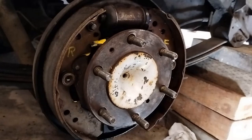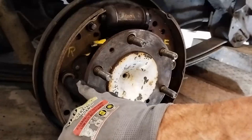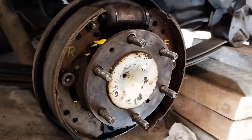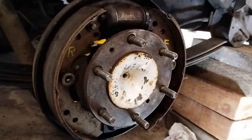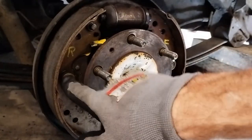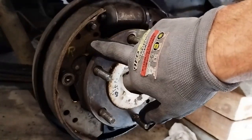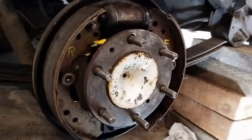The drum brake looks complex, but once you get your mind around it, it's really just the three springs holding it all together. These retainers will release the shoes, and then you've got your spacer. That's really all that it is. Reassembly, you put the bottom of the shoes in here, your retainers in, and the small spring with this spacing adjuster in place, and then you can reassemble.